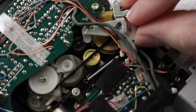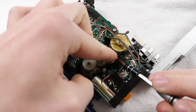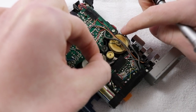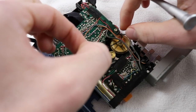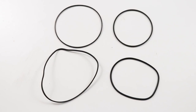I unhooked the little spring — we'll talk about that later — and then took off the belts. This gave me an opportunity to see just how stretched they really are. Over time these things become warped and there has to be a completely equal amount of tension all the way around so that when it's spinning you don't get any weird noises on the tape. You can see they're just not perfectly circular compared to the two new ones I bought.